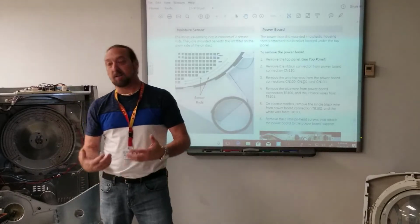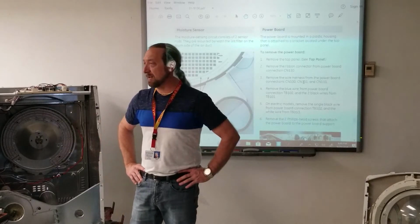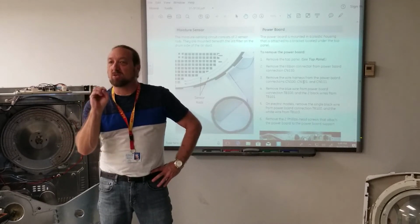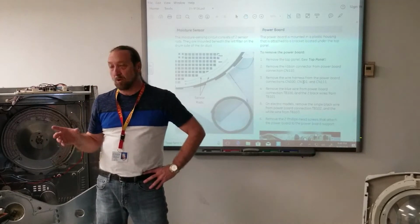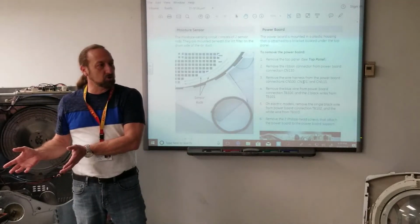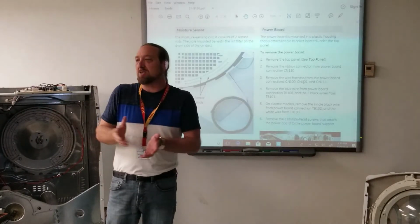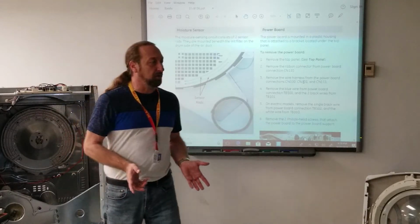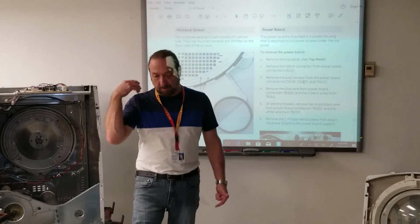So there are some advantages and disadvantages, and sometimes people may call you and say, hey, I'm using my dryer, but my clothes are still wet at the end of the cycle. Even though it senses the moisture in the clothes, it doesn't sense when it's close to dry, because the sensor detects conductivity, even though the clothes might have some moisture on them. So if you have heavy stuff like towels and jeans mixed with t-shirts, the t-shirts will dry sooner, and you still have some items that might be wet at the end of the cycle. It's not that there's anything wrong; the customer has a mixed load of clothing in there. Some will dry faster, and it depends on what hits the dryness sensor. So you need to know that, because the customer may call you and say, hey, my dryer's not drying.